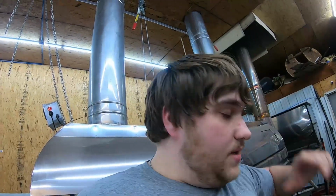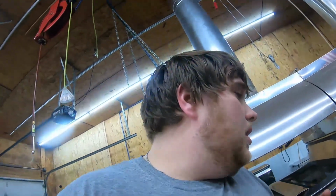Actually, crap. I think I'm going to have to take off the skid plate. Forgot that factor. But right now, what I'm going to have to do is jack this up, because as well as doing the Aero, I'm going to dial in the front alignment, because it was off going into sandblast, and obviously it's still off. So I'm going to have to cut the lock. I can't think of the term. Basically the nuts that are locking, backing nuts, I think that's what it's called, for the rod ends, for the steering.